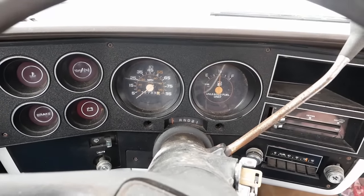All right, guys, I think I got it finally figured out. So the choke, this electric choke, from my understanding, it's not adjustable. You're supposed to line up the little notch with the little tab on the ear, and that's where it goes. As far as the carburetor, I've adjusted that APT stop as much as I think I can. It doesn't seem to get any better. I put the plug back in. I drilled and tapped a blind hole in that so I can pull the plug back out if I need to. I think we're going to put it back together